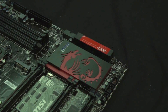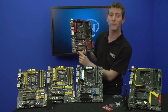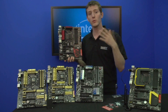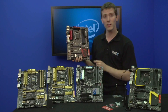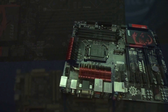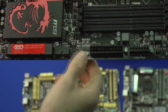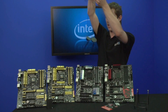They've got their same Dragon-themed PWM heatsinks that we saw on the Z77 gaming series, and you see onboard switches for everything from power and reset to OC Genie, as well as the Go to BIOS button, which allows you to shut down the computer and boot directly into the BIOS without mashing on the delete key. MSATA has been integrated if you want to run an MSATA SSD, and it has V checkpoints so you can monitor voltage of individual components using a multimeter. Front USB 3 is included, and it has 8 SATA 3 6 gigabit per second ports, as well as a multi-BIOS switch so you don't have to worry if you accidentally brick your BIOS during a flash.